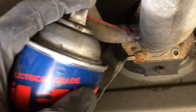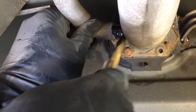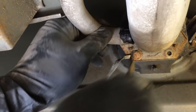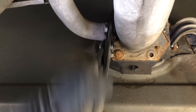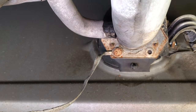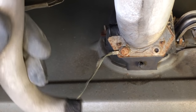What I like to do is use some silicone spray — get that up in there, let it soak in. I've actually pre-worked this. I take the plastic tool; I really don't like using metal tools when dealing with fuel lines. Just get it in here and keep pressing. When you first get it going, you might have to use a pair of pliers — I like pliers with a plastic lining so they don't tear up the rubber. Work it until the rubber has separated from being adhered to the steel nipple, then prise the hose off. This connects to the fuel tank so we need it loose so we can bring it down.